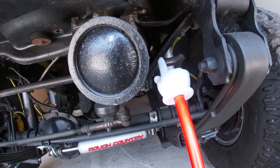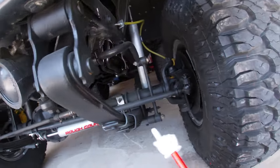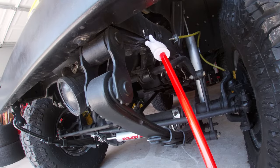I learned this the hard way through the forums and Facebook CJ7 pages — CJ7s with 33s and 35s that go off-roading tend to rip the stock steering box off of the stock brackets. If you ask me, that seems like a pretty dangerous thing to happen. So there's only one thing we can do and that's beef up the weak areas. These are the stock brackets right here, and as you can see they're pretty thin and they're connected to the frame of the Jeep.